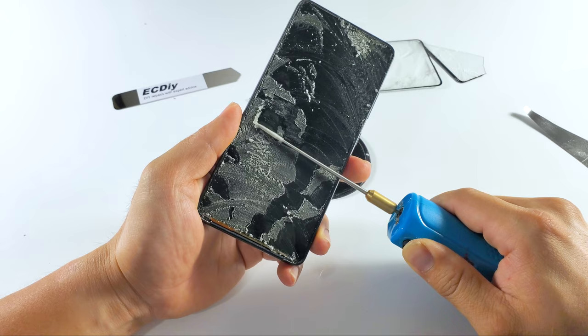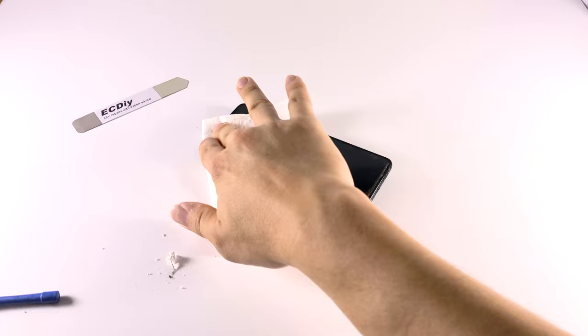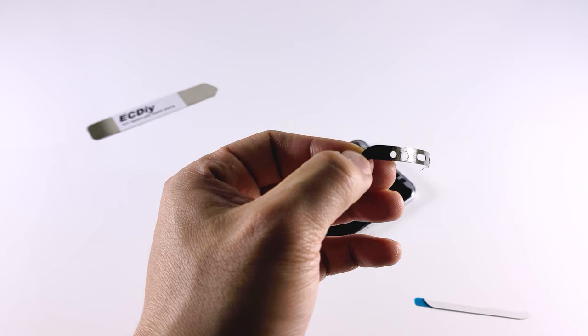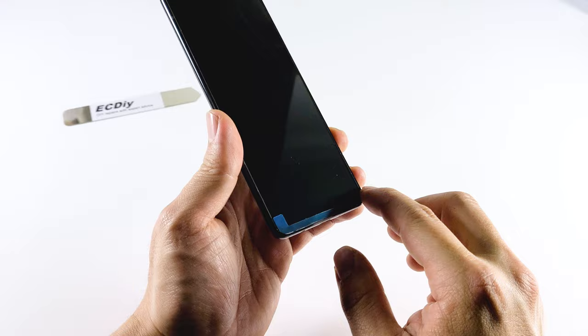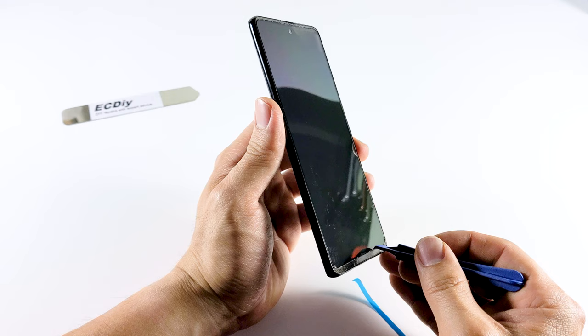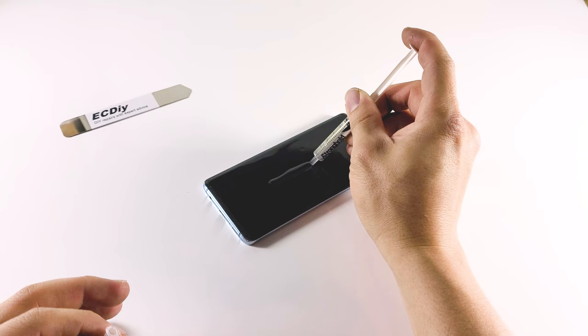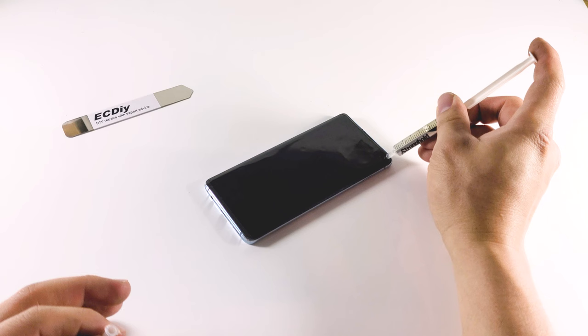When it comes to gluing the new glass, this isn't necessary for devices up to S9 and Note 9 series, but on newer Samsung phones where the camera is within the display area, you would need to remove the back glass and remove the front facing camera. Another accessory we developed is this IP68 tape that's going to help prevent the glue overflowing into the back and the sensor area. Now use the spudger to apply gentle pressure and seal the edges, being careful not to press on the sensitive flex cable that runs across the bottom before dispensing the glue in a dog bone shape. For S10 and up, dispense two drops of the adhesive on the other side of the camera as well. Once done, lower the glass slowly, one side at a time to avoid any bubbles.